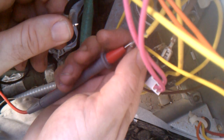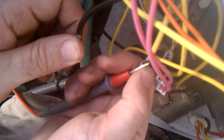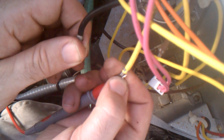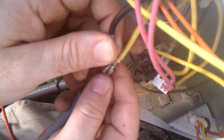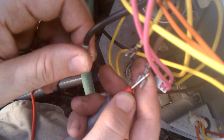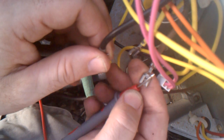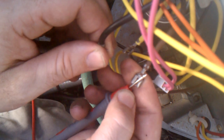So you just go like this. This is the defrost board wire to the common plug. And I get a reading on the multimeter of about 125 ohms. And then do that with the other winding — get a reading of about 45 ohms.